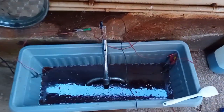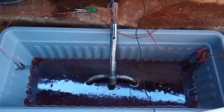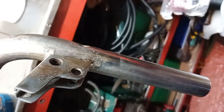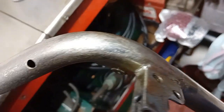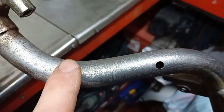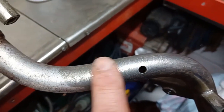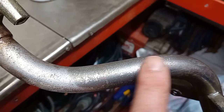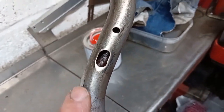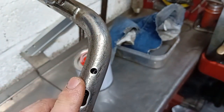Sun is going down, so it's got to be around about six o'clock. Let's take it off and take a look. You can't quite tell if any nickel's been deposited, but when you get to the point where this part wasn't submerged, you can see a line there. So this has definitely had nickel plated onto it, but this part hasn't. Same goes on the other side — there's a line there and this bit has a plate applied to it.